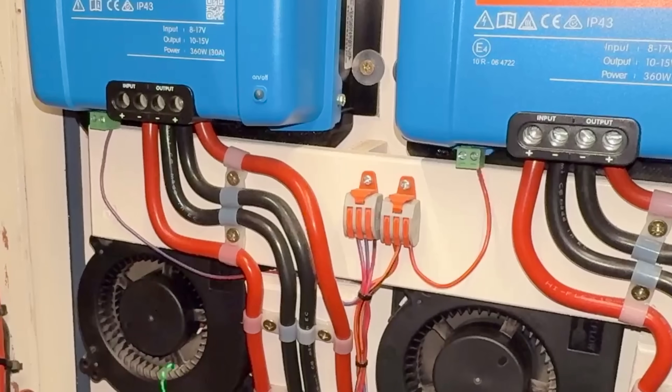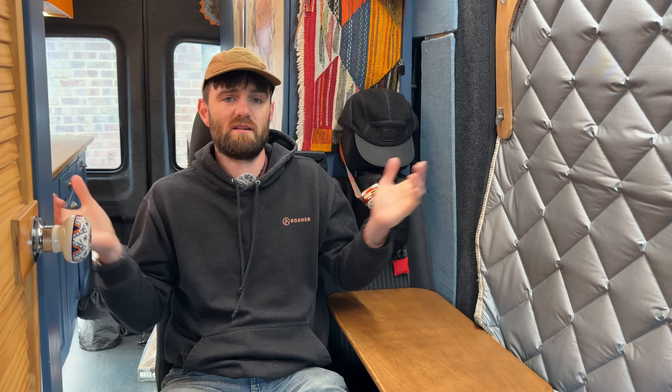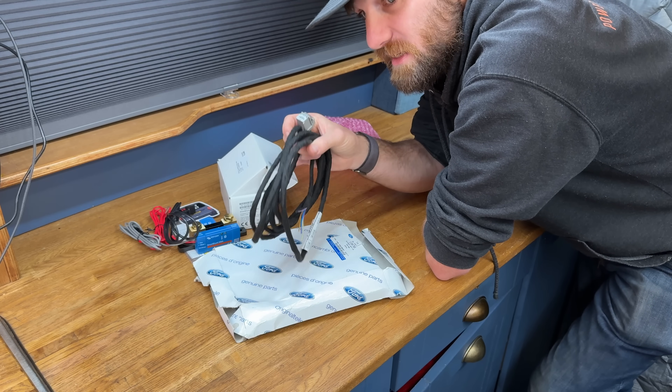And that's pretty much everything. One thing to bring up: whilst you can have a signal live to the DC-DC charger and turn off the engine detection mode on the Victron ones, that isn't the problem here — I actually have ignition lives running them. It's that even though they're on, they're only getting about 200 watt output because the alternator was off and there was nothing to pull from. If you've made it this far, I hope this video has been some help. Whilst I've shown the rather expensive Ford connector, you could find the connector name, buy it online significantly cheaper, and make your own cable — or just bridge those two wires yourself. If you've enjoyed this content, consider checking out my other videos from the Arctic or my other technical reviews and how-to's. Thank you for joining me and I'll see you next time. Cheers, bye.